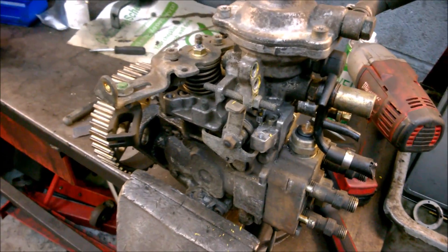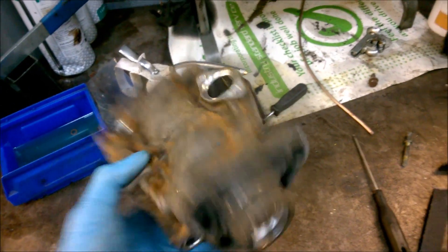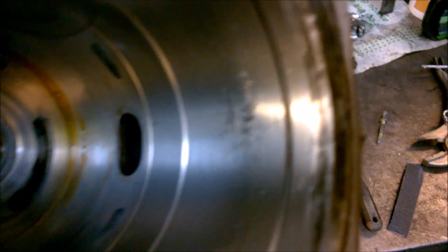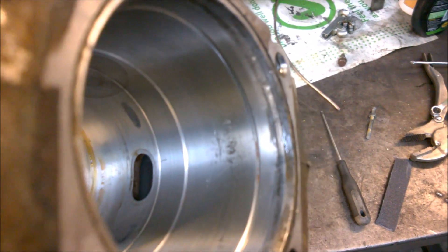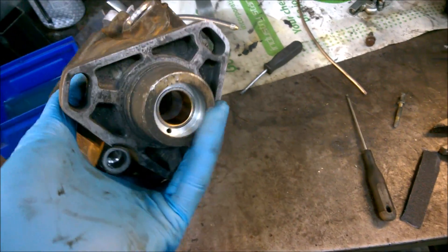The strip down has changed — I was going to show basically an 11mm pump conversion, but this is a semi-ECU job so I need to swap over the body. I happen to have a spare body but there's a little bit of scoring there. It's not ideal, but the head sits on that bit so it doesn't really matter. I've got a couple of bodies I might change my mind.